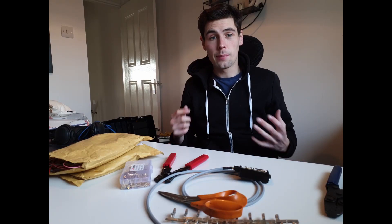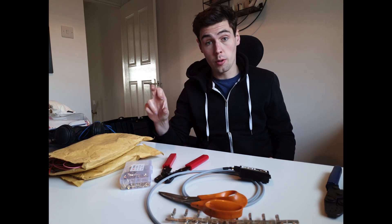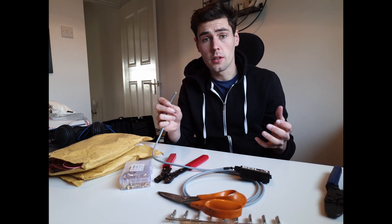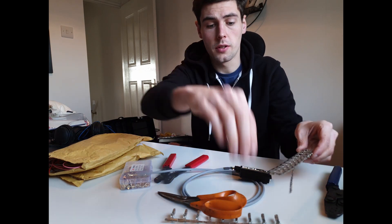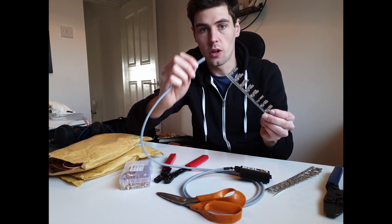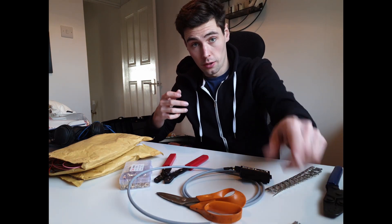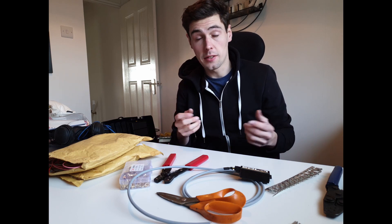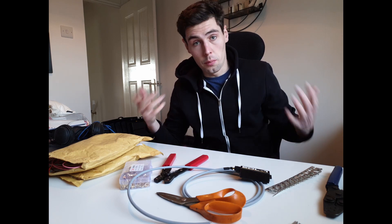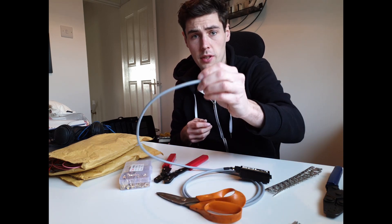On my EMU Black, I'm not actually using any of the pins I need on the EMU Black connector. However, what I'm going to do is crimp one of the terminals onto a larger gauge wire, and then crimp this onto that wire. That means in the future, if I ever want to use those particular pins for anything else like sensors or use the sensor ground for more sensors, I can do that without having to mess around with this cabling.